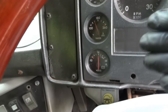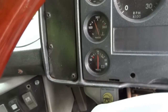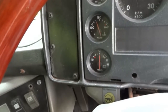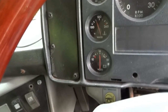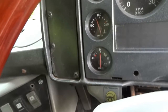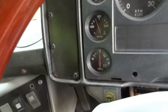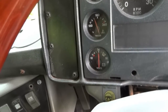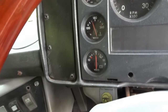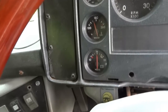Again, this is intermittent. I believe what's going on is the resistance on the sensor is changing intermittently. So when the resistance is fine, it shows a good reading, and when it goes out of whack, we have an inaccurate reading. It's been freaking out the driver because he thought the engine was overheating while it wasn't. These temperature sensors are really easy to replace — I'm going to replace them and bring you guys back.